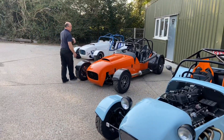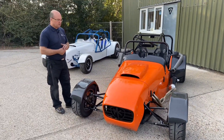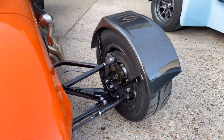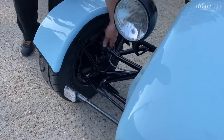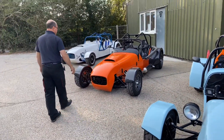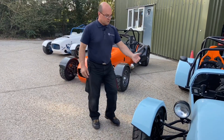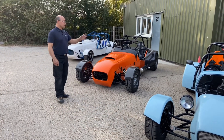So that's the CBR booster. You've seen this one — we've been testing it, done some run-outs. The Indy RR booster, we're just putting some road miles on it to clock it in and dial it in. It's got billet uprights — those are Cortina-based — and then the standard Sierra-based one. You can see the difference between the two. We've got the standard Sierra upright on this one. Ninety percent of customers go for the billet new part, but we still do the Ford Sierra-based ones. Geometry-wise it's different for the Cortina top wishbone, but you can retrofit those afterwards if you want to go Cortina later.